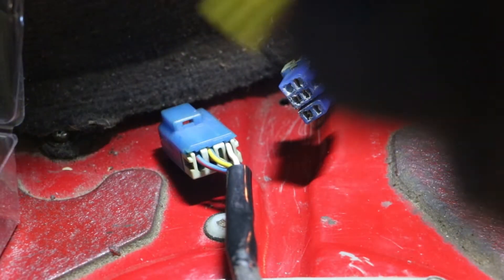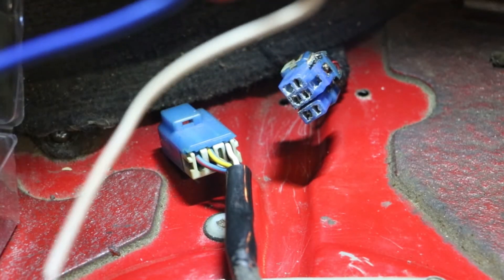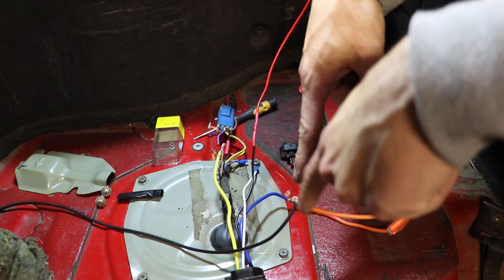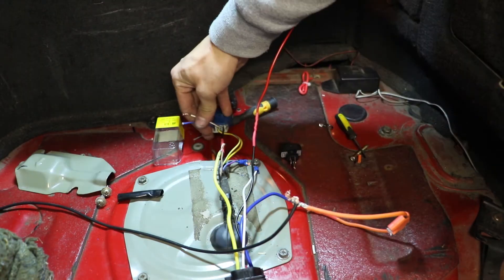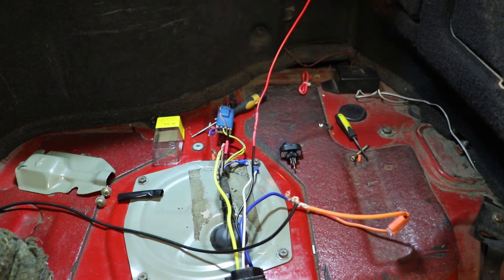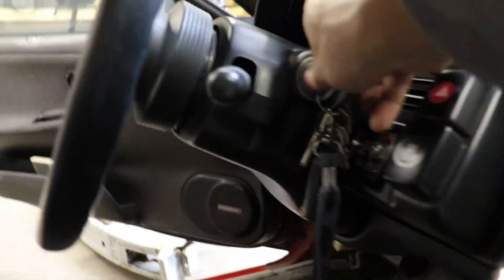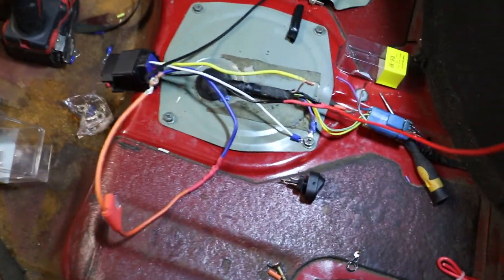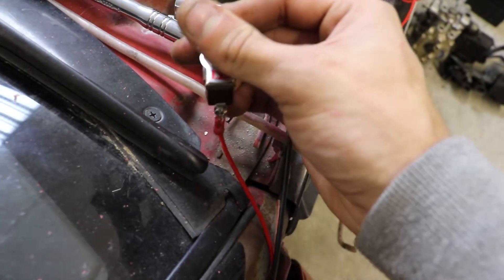Let's start wiring it up and see what we can do. Here is the relay I bought — it's a waterproof one, so that's probably the best to get. I'll put the part number in the description. I got everything hooked up to the relay — it's a mess right now, this is not the end product. I just wanted to make sure everything works first. I eliminated two cables from the plug and I'm going to directly hook it up to a switch to the front of the car so I can turn the fuel pump on and off. When we turn the ignition on and flip the switch, you can hear it — the fuel pump's priming, everything's working. When we want it off, just turn it off.